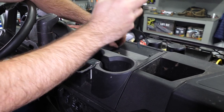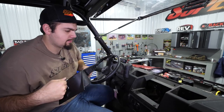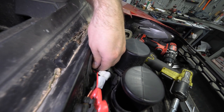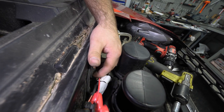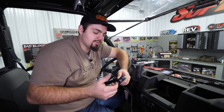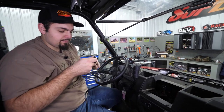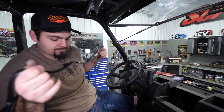Next we're going to remove the top portion of our dash that has the two cup holders in it — it just slides right out. We're going to see that we have a grommet up inside of here. If your grommet's not already opened up, just open it up — a lot of times it'll have cuts already in it. We're going to take our rocker switch. We ordered the winch dash-mounted rocker switch instead of the rocker switch that came with the kit, but the installation is pretty much the same, except the one that comes with the kit doesn't go into a rocker switch hole on your panel. As far as routing your wiring, it's going to be the same — you'll want to come through on the inside, just like we're doing today.